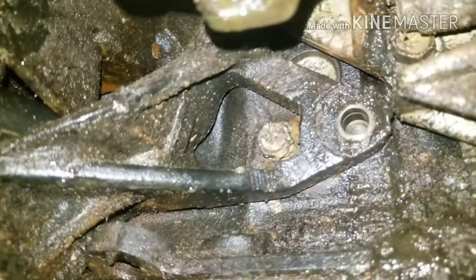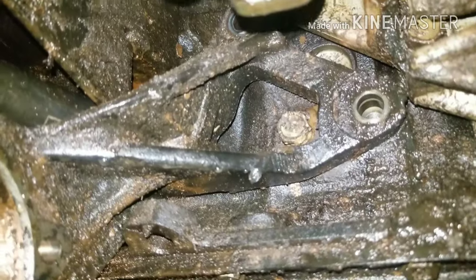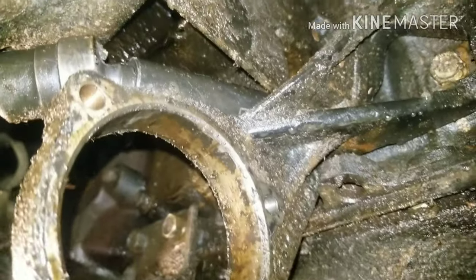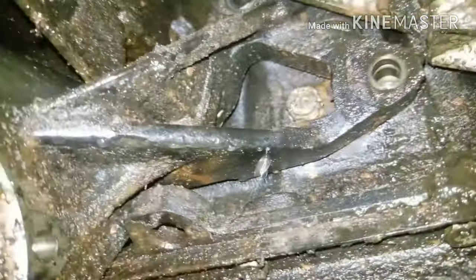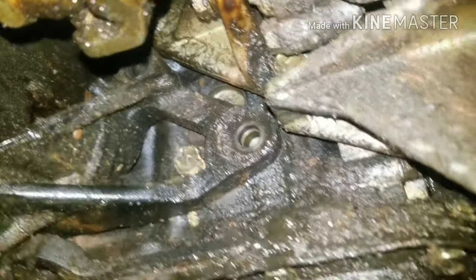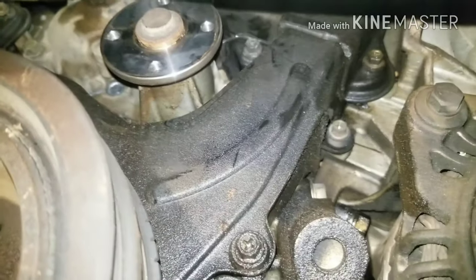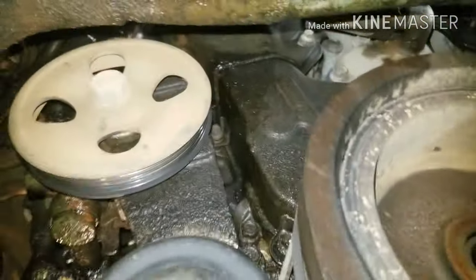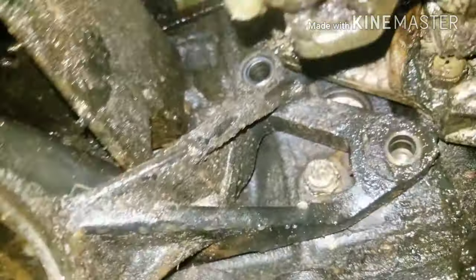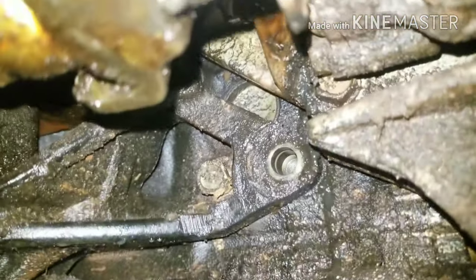Because sometimes you get the factory one, try to stick it in there, and if you hit it too hard it'll go right through. The one with the rubber shim in the middle will actually lock it in place. So we're going to get this done and stop the leak. Just one of those weird things that happens on vehicles sometimes — you get the symptom of maybe it's the water pump, but it's not always the water pump. Any time you have a coolant leak, it's best to lift the car up, take a good look, and follow the trail of where the water's coming from. In this case, we follow the trail around and it's the freeze plug.